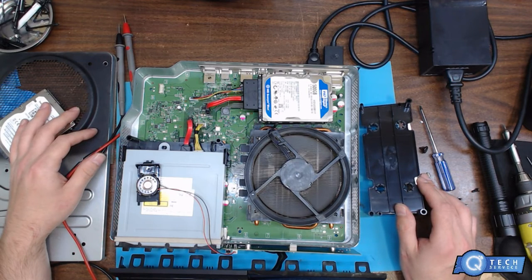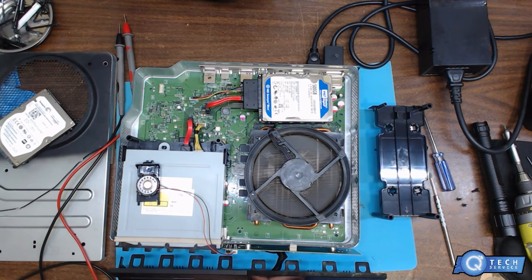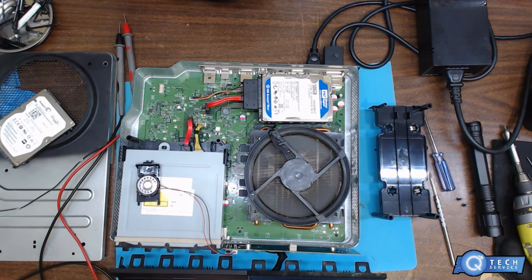At least the board is nice and clean and got all that corrosion off on the other side of it. But it was water damaged at one point, so it's booted. You can see the fan still spinning. It says something went wrong with your Xbox on the screen. It says, reset this Xbox. So what I'm going to have to do is put this together with the hard drive. But what I'm going to do is format the hard drive and then install the operating system, which isn't fun on the Xbox One, but